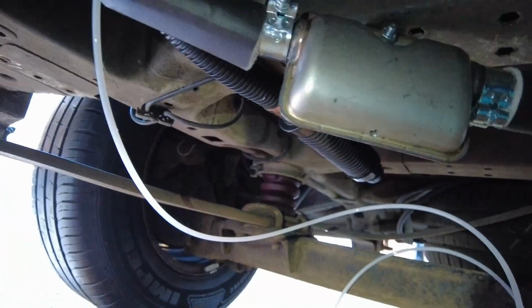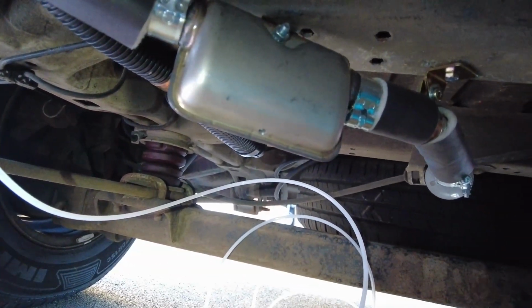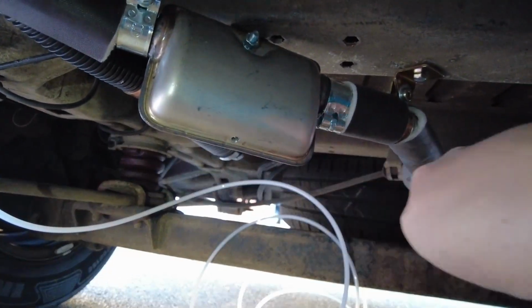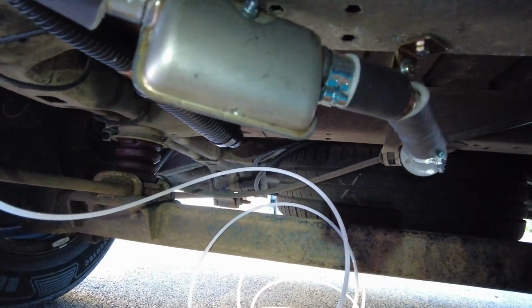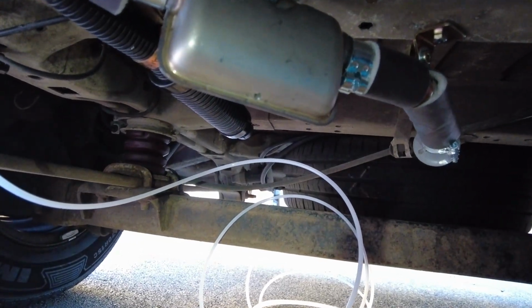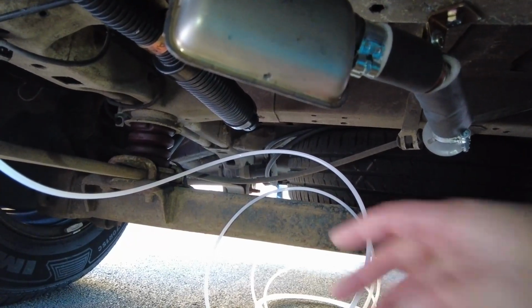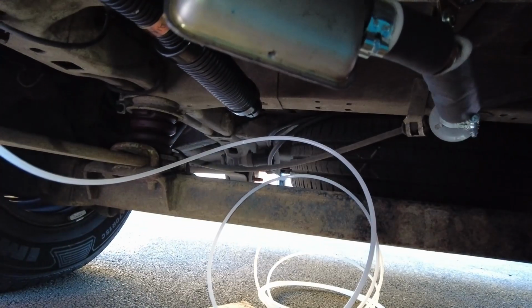The other rules is that they both have to face in the same direction, which is that way, rather than having one left, one right. They also both want to be facing backwards or sideways. They want to be never where the sort of airflow of the van when you drive in is going into your air intake.